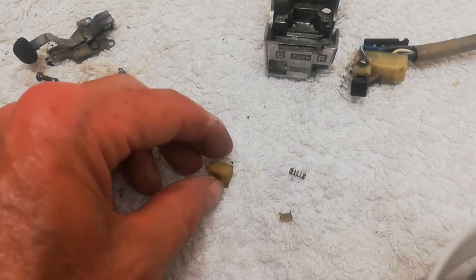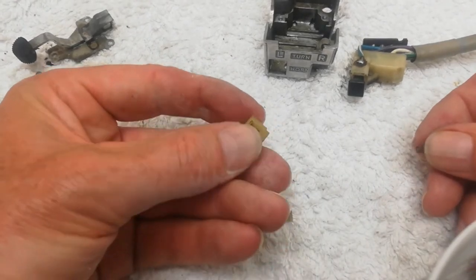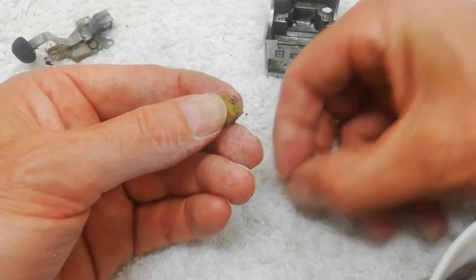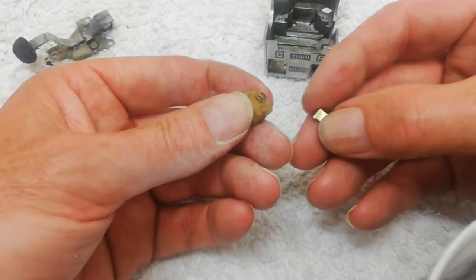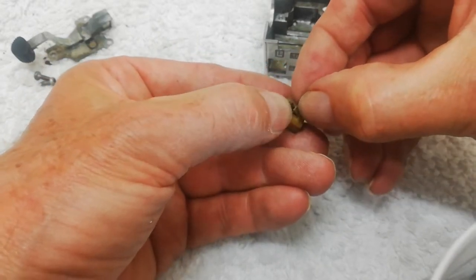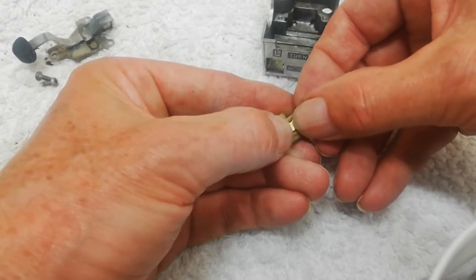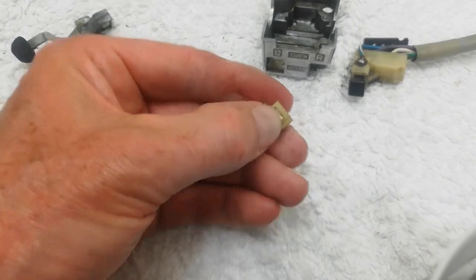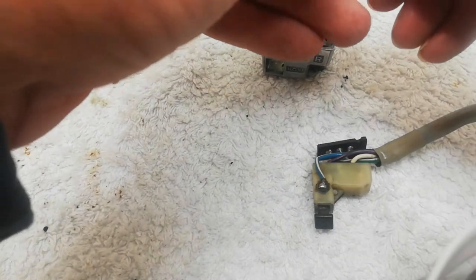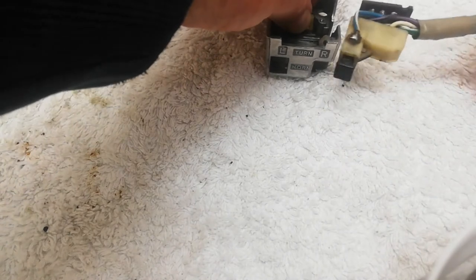Okay, I'm going to put the switch back together now. So basically, that's the little operating block. I've cleaned everything up with white spirit. And the spring goes in there. And then I've cleaned up, this is the contact. And it goes in one way, fortunately. You want the two little ridges to the sides, not to the top and bottom, but luckily it'll only go in one way. So you can't get it wrong. There, and that's the spring-loaded contact that will then operate on these connectors. And what will happen is that goes in there, and then this slides on top.